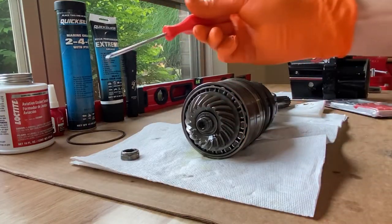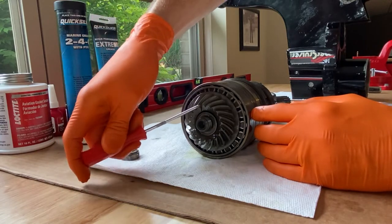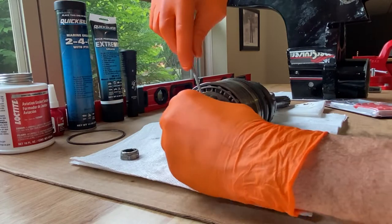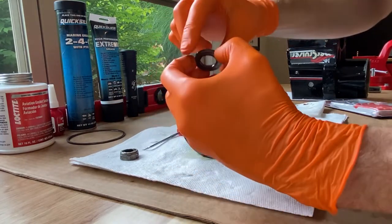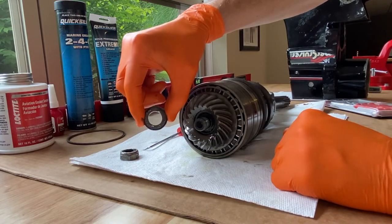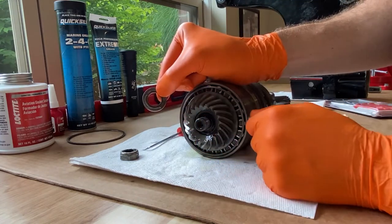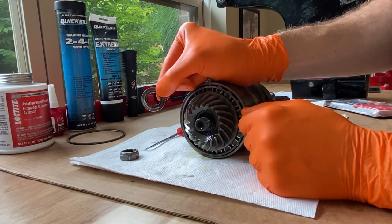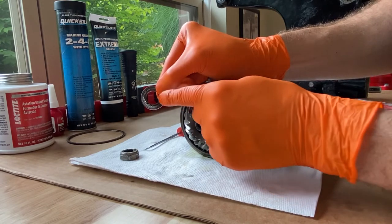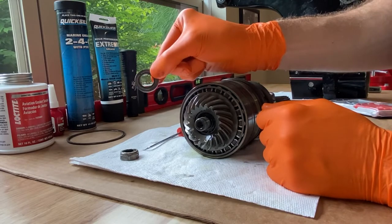I've got this little pick tool here, and I'm going to carefully shift the washer off without scratching or damaging anything — but in my case it doesn't matter because I'm replacing everything with new stuff. You'll notice one side says 'nut' and the other side does not say anything. When you reinsert your brand new washer — because these old washers cannot be used again — they are already compressed with the preload, and if you try to use an old washer to set a new preload, you are setting yourself up for disaster. Replace the washer.